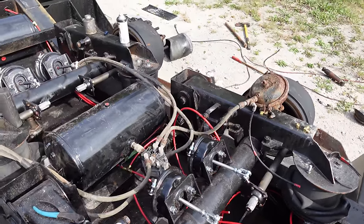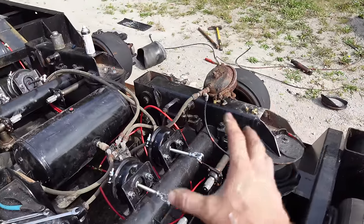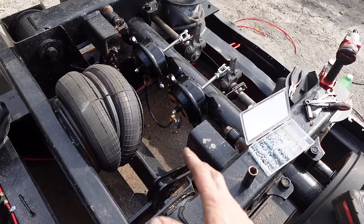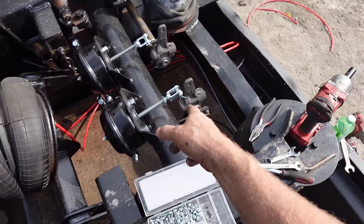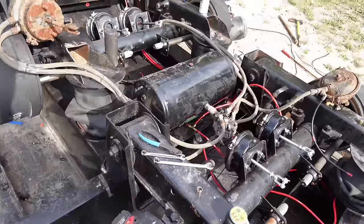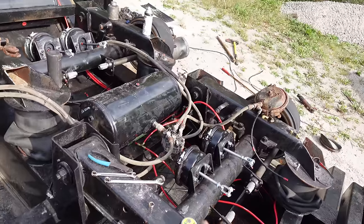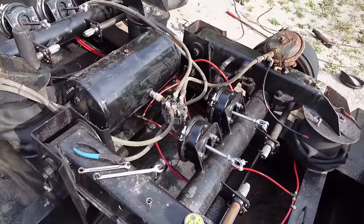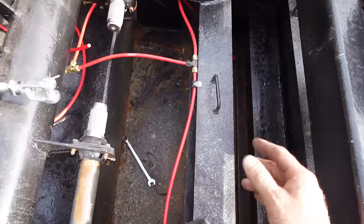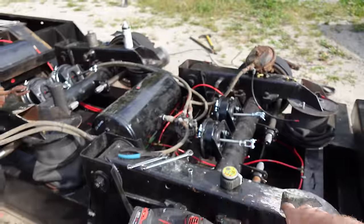Perfect. Okay, smart. So replacing all the fittings and the lines, thread sealant where I don't want it to move ever again and never seize on the parts that I do want to have move again, but I'm getting closer. I know that I'm still gonna probably mess some stuff up, but that's okay. We'll figure that out. We can air everything up, make sure that we got no leaks. We're tying all the hoses down so that they don't rub, keeping in mind that anything that's on the axles will go up and down with the airbags.